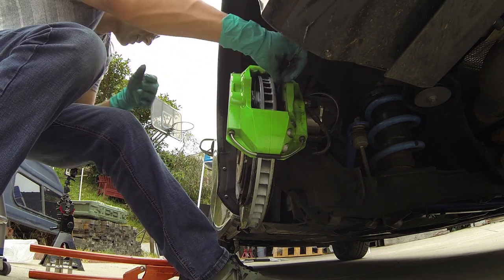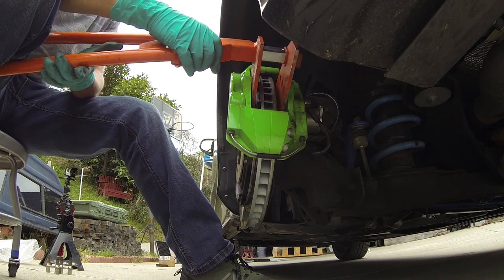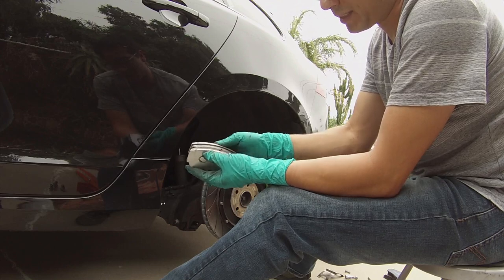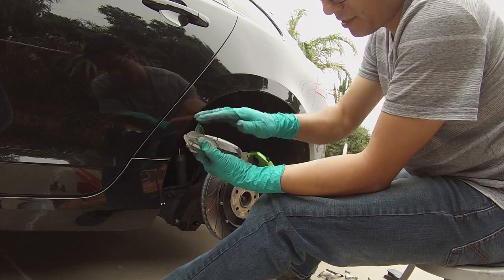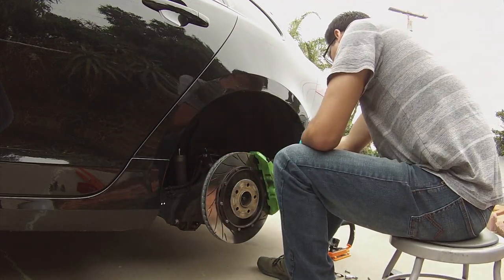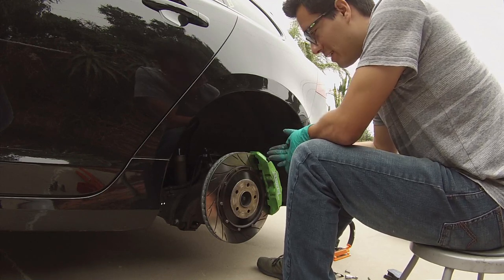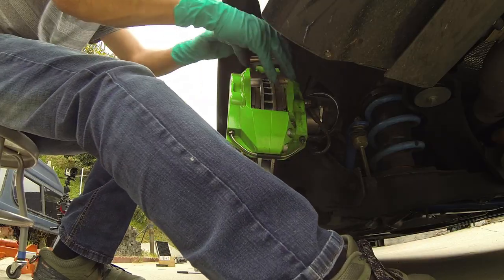So again I'm going to go in with my tool — those feel pretty good, but I am going to be putting in some fairly new pads, so I just want to make sure everything is compressed. Now I have my H2 pads. Yes, I've been running on these — I even did a track day with these ones and you can see we've got a couple little burnt spots. But the pad itself is fairly good — you still have your chamfering there to prevent squealing or noise. Very good ceramic compound. Slides right in on both sides. And again, you do not have to do anything with your electronic parking brake — just make sure it is off when replacing any rear brake setup. Put your bridge in.